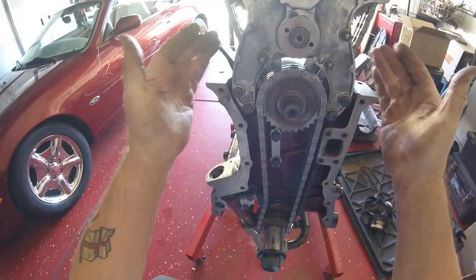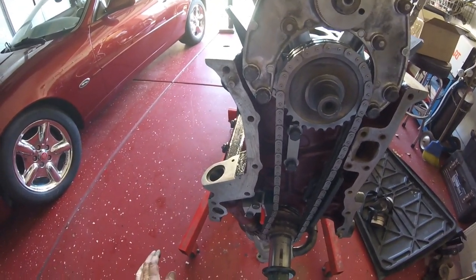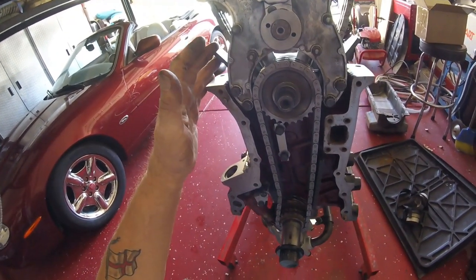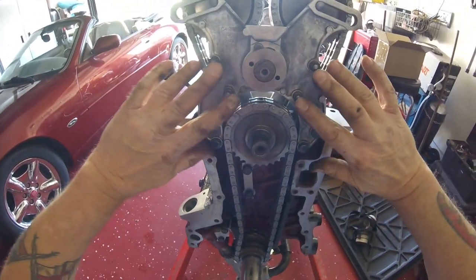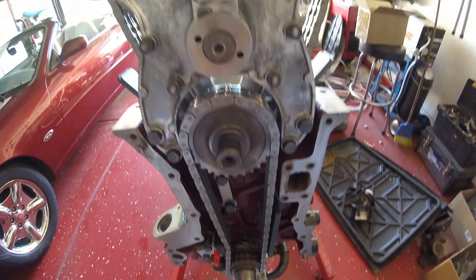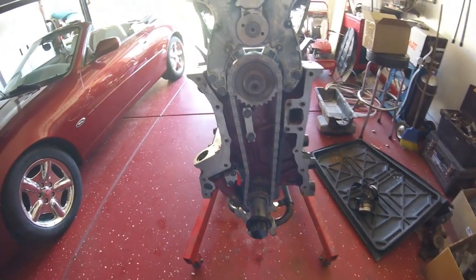A little side note - these ones that I put in up here, I should really have put them in when I was assembling the whole unit. I forgot. It's annoying, but you've got the spacers there, the guides, the chains, so pieces are falling everywhere. These probably should go in afterwards like I did it, but it does mean you need to loosen these nuts off and then get it slightly apart and then fiddle it in there.